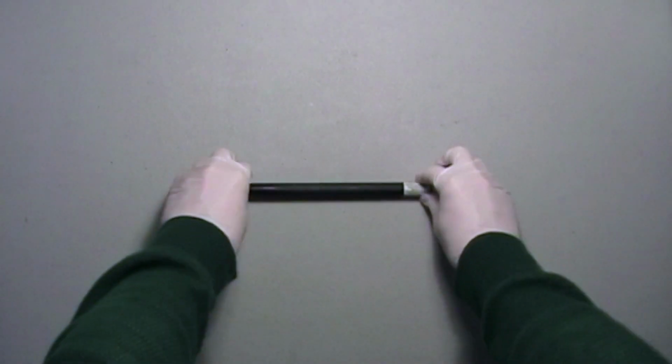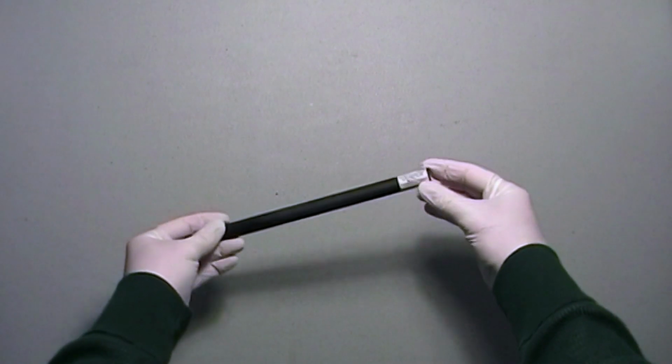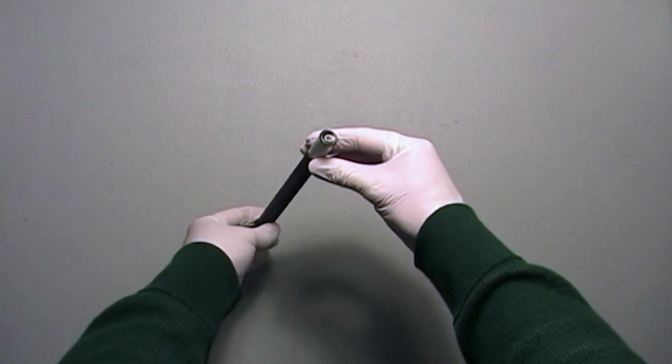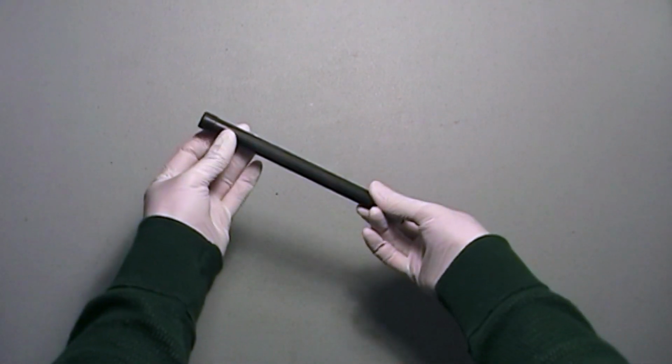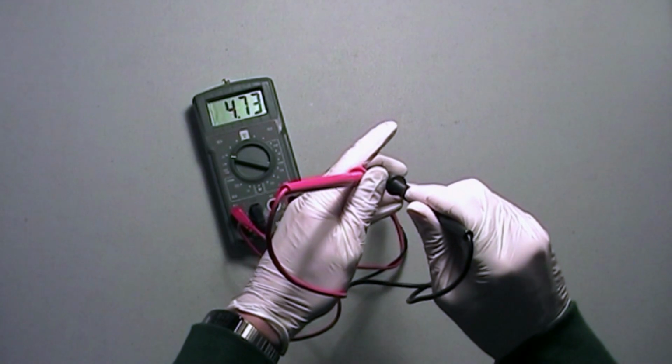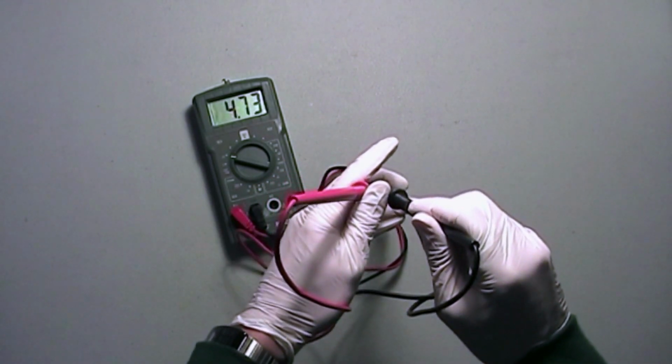This is the battery unit for a Watchman Oil Tank Monitor sender unit. They call it a power tube. What it actually is, is 4 AAA batteries inside a copper tube. A replacement power tube is about £35, but you can replace the batteries in an existing one yourself. It should be 6 volts, but it's 4.7, so it definitely needs replacing.